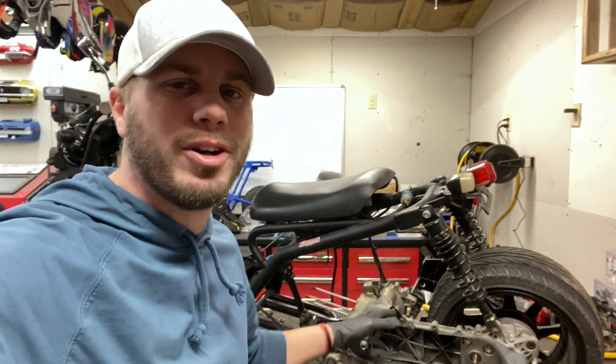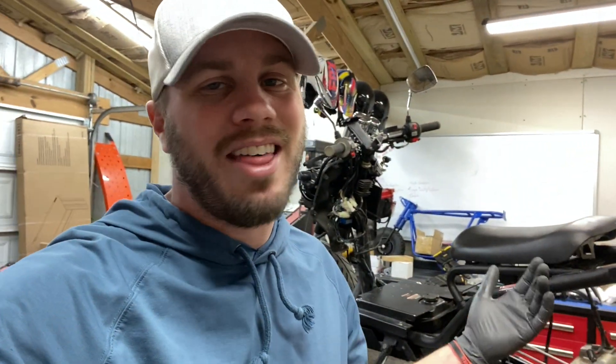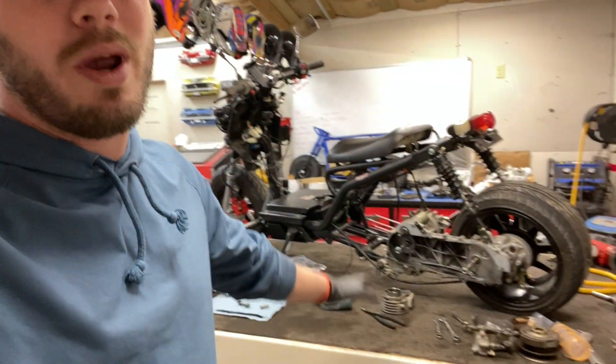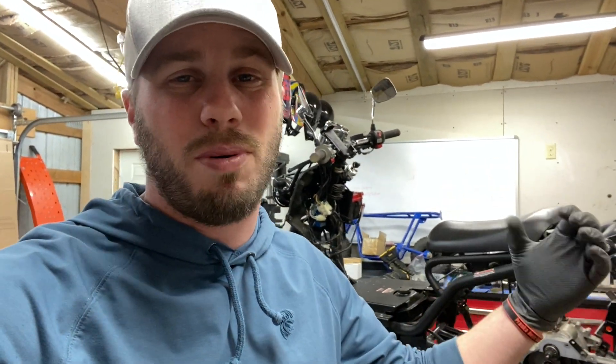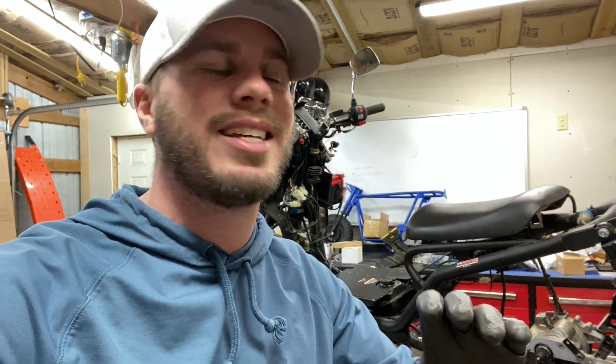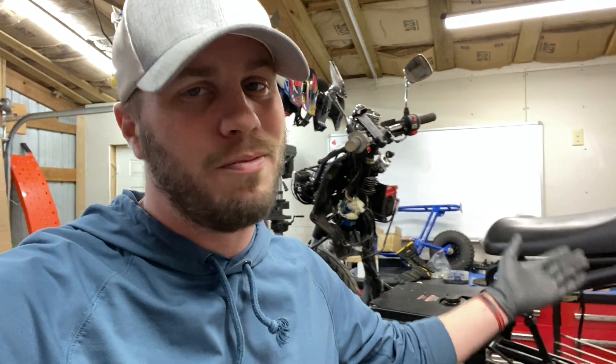In the last video I had mentioned this was going to be an easy project and for 200 bucks it was a great deal. Well, now we find out that you get what you pay for. With that rod being bent there's nothing we can do besides break it all down. So we have a long day ahead of us — we're going to take the motor off completely, completely disassemble it, because in order to put a new crank in, it's all one piece and we've got to split the case.